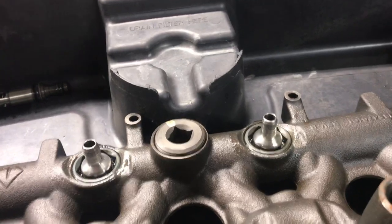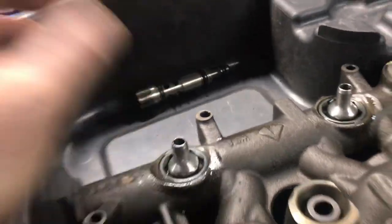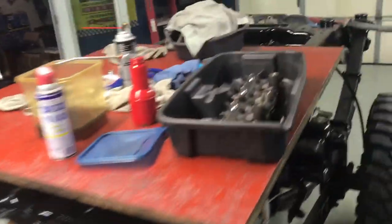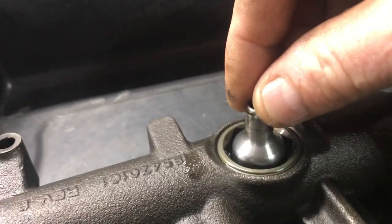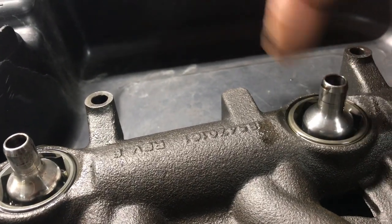Alright guys, Anthony your super service, here we go again. We got a full set of injectors here — they should snap on pretty good. I use guide studs to put them on and take them off, both on and off, so these nipple cups stay good. These had to have been replaced. If I can wiggle it like that with just a little bit of pressure, there's a problem.